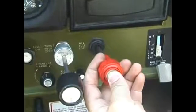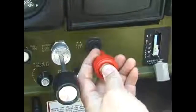Now we'll start the engine. We're going to make sure our mixture is rich — this controls the amount of fuel going to the engine, so we want it full forward, or rich, to have the most fuel going to the engine. Next, we want to make sure our carburetor heat is cold, so this plunger should be pushed in for carburetor heat off.